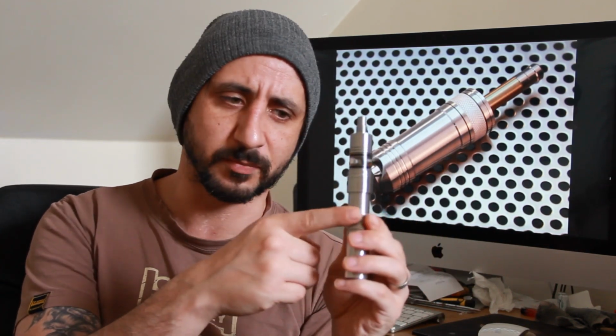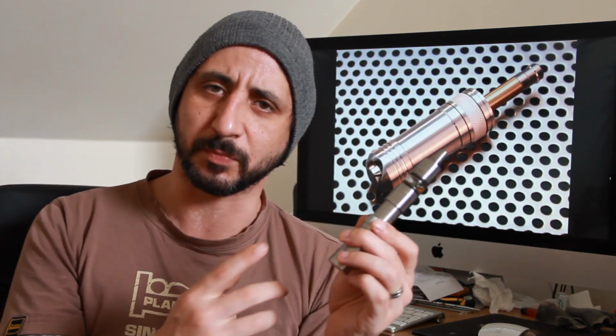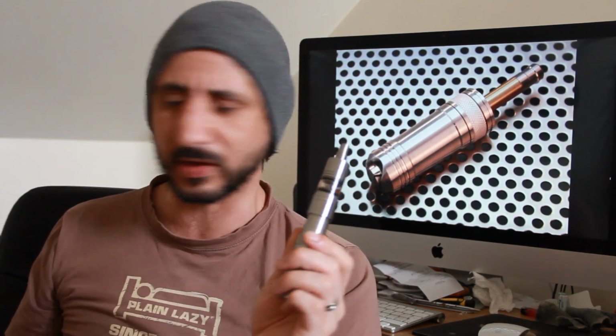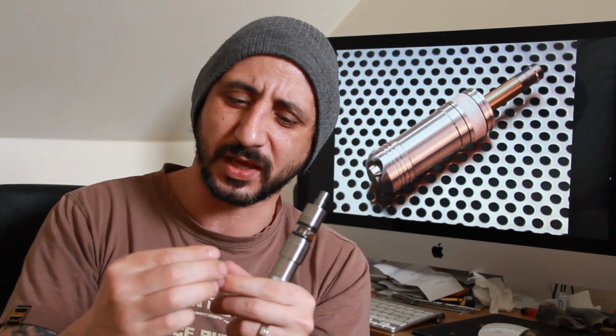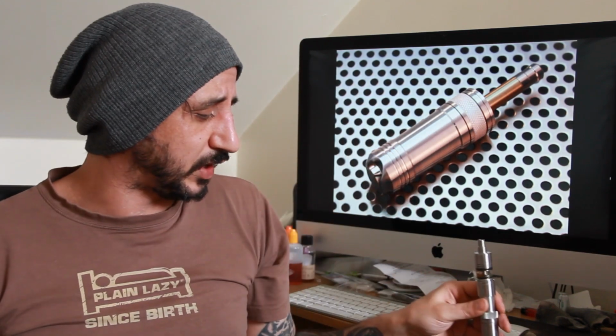But they are at the moment selling the ELA 2. I mean, this is the ELA 1, the classic ELA, if you want to call it that. The ELA 2 has had some small changes done. The knurling on the centre ring has been changed to a single stroke cutout now. They are coming with solid top caps, and also the button has been addressed and has been made flat with the bottom cap, and also a larger diameter, unlike the original button that you got with the Super T, which was quite small and also stuck out a little bit from the bottom cap, so you couldn't really sit it down without locking it, and plus it wasn't very sturdy when sitting it down anyway, which is pretty much why the aftermarket caps and switches were made, so that you could sit it down and leave it without worrying about it.